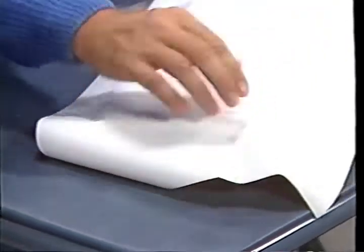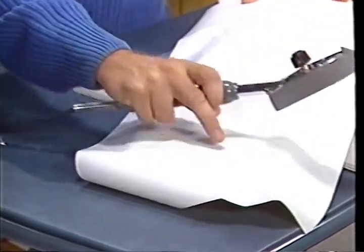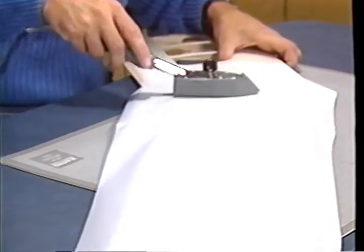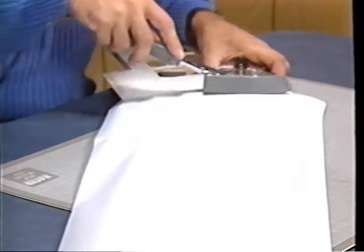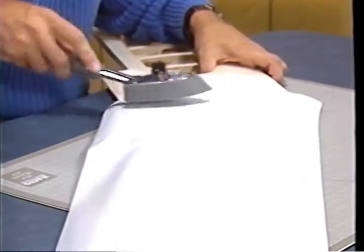Make sure most of the wrinkles are out. You're going to want to temporarily give a little bit of a hit here with the heat so it doesn't flop around. Next step will be starting from the middle, like so, and in a little patch at a time, work towards the leading edge. Again, keeping it low temperature and working towards the trailing edge.